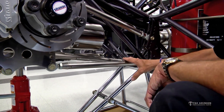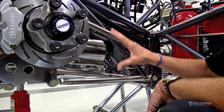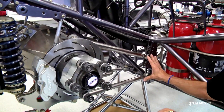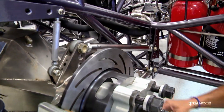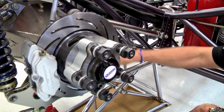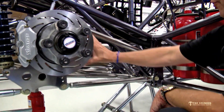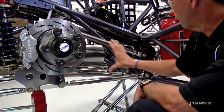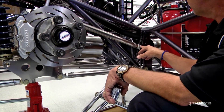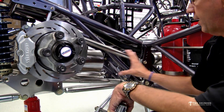There are a couple things to keep in mind when we talk about four-link settings. Depending on whose rear end housing you have and what hole locations you have back there, you have spread numbers — a front spread and a rear spread. Your front spread is the center-to-center of the two front bolts, and the rear spread is the distance between the top four-link bolt and the bottom four-link bolt on the housing bracket. Those two spreads make the length of the intersect point. If you project a line through the center of these bars, they would intersect out at a point up around the back of the transmission.